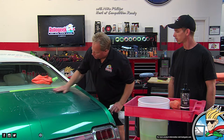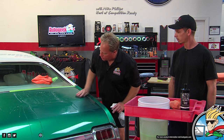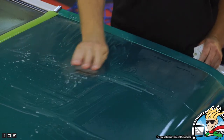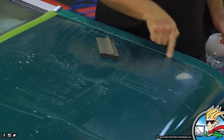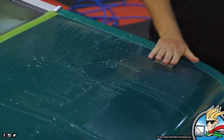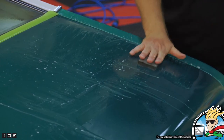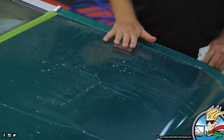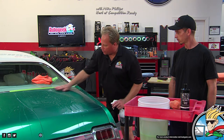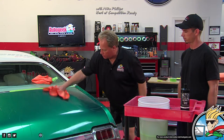Or you burn through the edge. That's why I tell people, if you go to car shows and look at a car that has a custom paint job, in the middle of the panel there's no orange peel. If you look up to the edges, you see the peel kick back in. That's because sanding to the edge and then pulling your sanding marks out to the edge takes a long time. If it's your car and you've got the time, go for it. Most people don't, so they take the route I'm talking about. They sand close to the edge, so they only have to buff close to the edge. They don't burn through, and then they don't have to buy somebody a paint job. If it's your own car and you make a mistake, you can pay for it yourself.